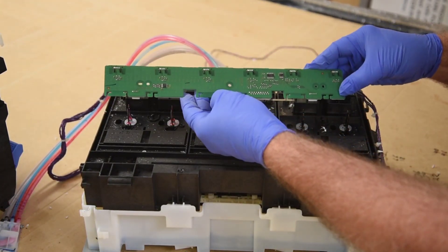Looks like just two screws hold it to the white tray - it just lifts right off. No ink dripping down, but it's been months since it had an ink cartridge in it. I'm starting to make a mess. I've got my old messy clothes on, but I still don't want to splatter the ink on me. I've seen this ink soak through plastic gloves, so it can't be good to get on the skin. Let me tape a couple of paper towels around the ink tube connector - maybe just a little bit of ink in the tubes and the towels can absorb it.